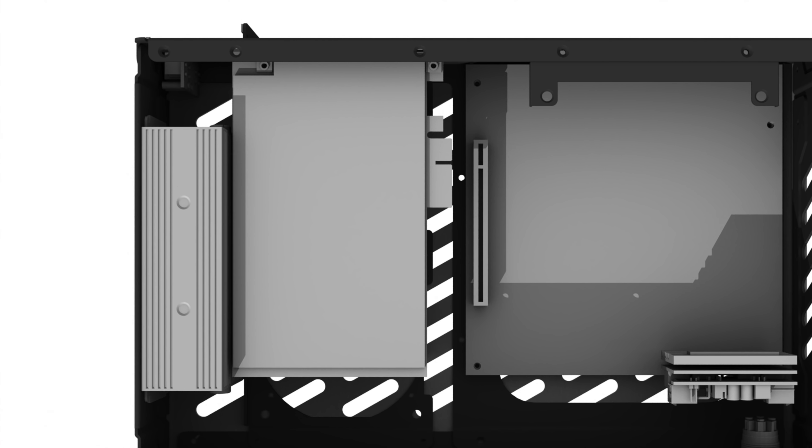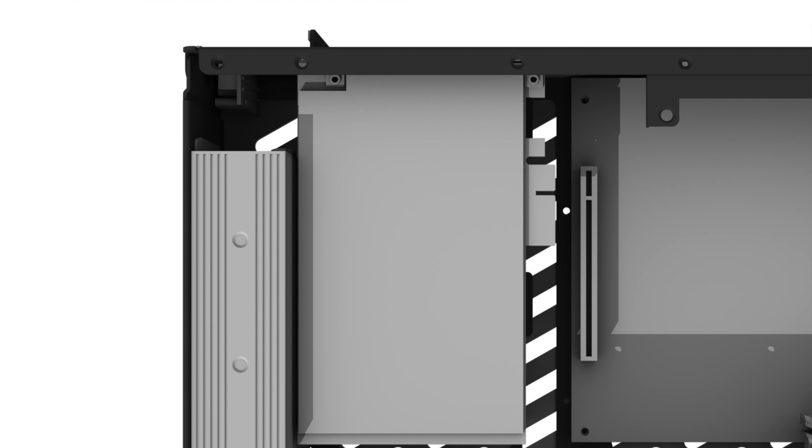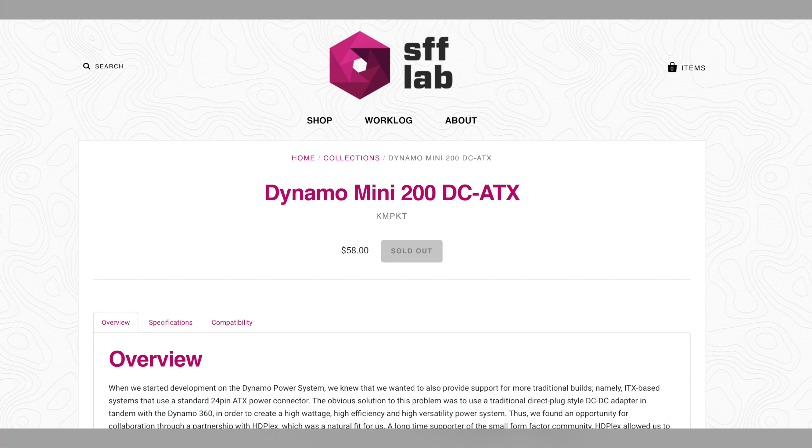That's one of my absolute favorite combos and what I'm running in my office right now. I play a lot of PUBG, and with screen scale set to 70 and graphics turned low — which helps my old eyes anyway — I can get over 60 FPS at 2560x1440. For Fallout 4, Blizzard games, and Civ 6, the 1050 Ti is more than adequate for eye candy and frames, and has plenty of CUDA cores for applications that take advantage of it. You can also use the 160 AC-DC with any normal-sized graphics card.